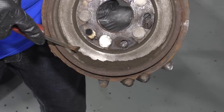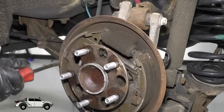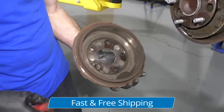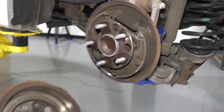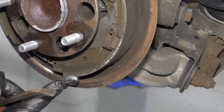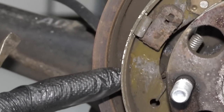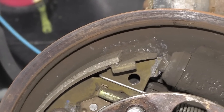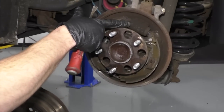Now with the drum off, we can see there's a severe amount of brake dust inside — that just means the brakes have been doing their job. Your friction material rubs on the drum surface and this is what you get. Put it in a bag or the trash — anything but pouring it on the ground. Then inspect the brake shoes. Make sure they're in good condition. This one looks fine; this one is nice and thick on one end, getting thinner toward the other. Depending on your state, this might be close to the point where a state inspection requires replacement. It looks still safe. We're going to clean this up and dispose of the dust properly, then get going on this wheel cylinder.